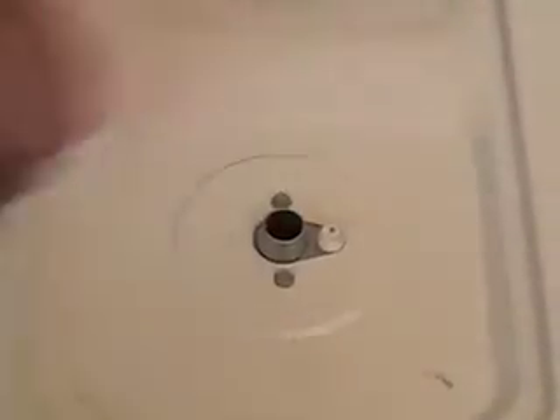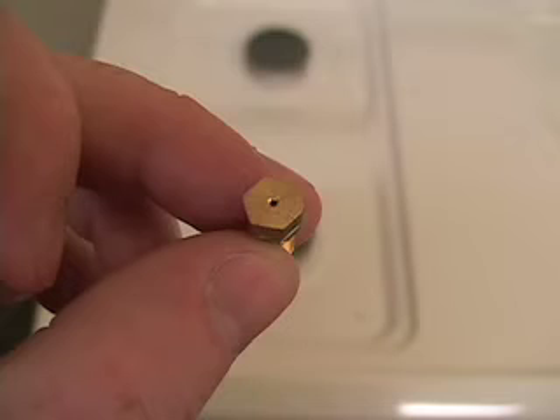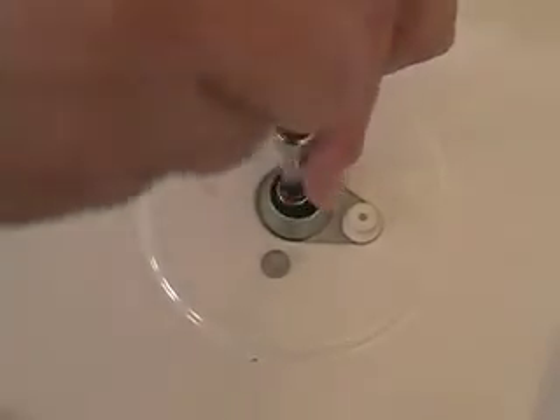The other three burners are the same. Remove the burner cap and head and remove the natural gas orifice. According to the conversion instructions, an orifice with no color dot is needed. Replace the orifice and the burner head and cap.